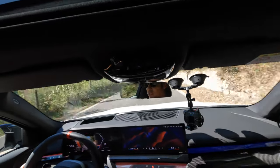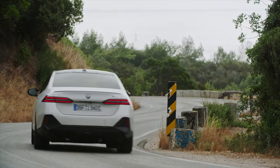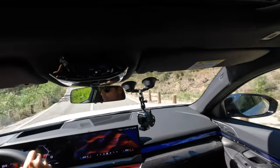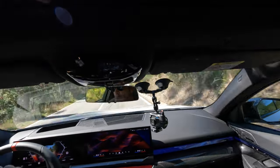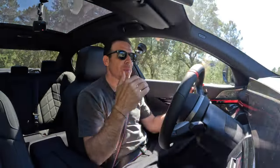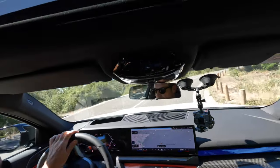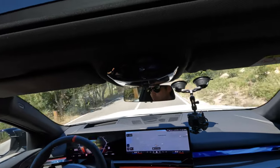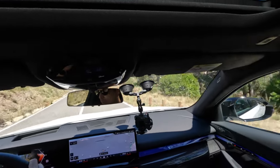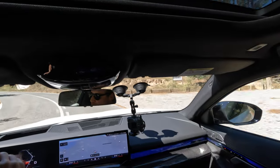Definitely a lot sharper overall. I can feel the suspension being a lot sharper and tighter. There is less play in the rear — the rear end is not as playful at first glance. Going over the same speed bump several times with the E40, I can tell the suspension was a lot more compliant there, nicely absorbing the shock, versus this one which is a lot sportier and stiffer. Also, the brakes — I'm pretty sure they're upgraded because they bite a little bit more. I'm also in the adaptive brake region, so not a one-pedal feel yet, but they feel more aggressive. It's the same brake-by-wire technology, but I have a feeling this one has the upgraded rotors.